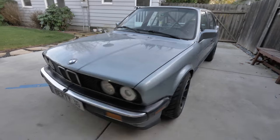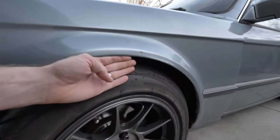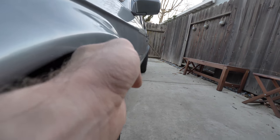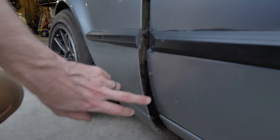You're probably saying to yourself, what the heck are you talking about? If you look at this side of the car, you can see the fitment is pretty good — we got it nice and lined up. However, you can see under compression that this could possibly hit when it was kicked in a bit more. This fender is actually kicked out about an inch.